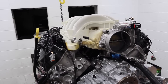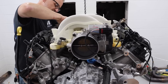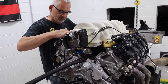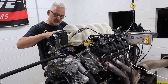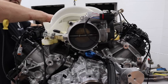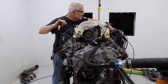So this intake manifold, as we covered with Dave Born and Mark Wilson when we were over at Ford Performance this morning — a little bit shorter runners, which will promote a power band that's up a little bit over stock as far as RPM, and they're a little bit bigger than the truck manifold as far as volume, so they flow more air. The throttle body is facing forward, and the reason this thing is a whitish color is because it's a prototype — the production ones will be black. The throttle body opening is also bigger, so again more airflow. As soon as Brian straps this on there, we will fire it up and make some pulls.